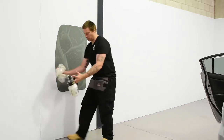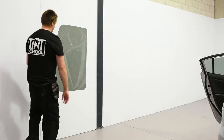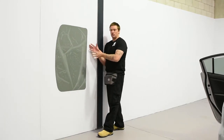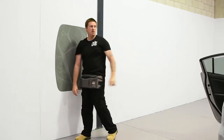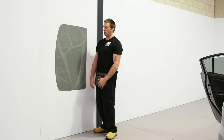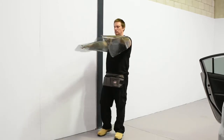In an ideal world we've got a nice black bin — just put the liner in that. Now the film's ready to pick up. This is the bottom of the window so I don't want to pick it up from the bottom because then I'm upside down — you always want to pick up from the top edge. On a hatchback things kind of reverse so you'd pick it up from the bottom, but because this is a sedan I'm picking up from the top. There are a lot of different techniques — they call it the California roll, or the kangaroo roll — but right now we're going to do what you guys call the Frankenstein.